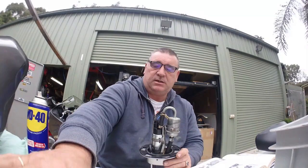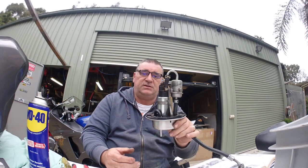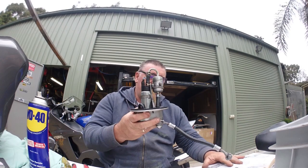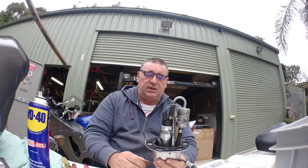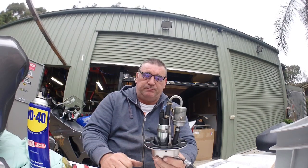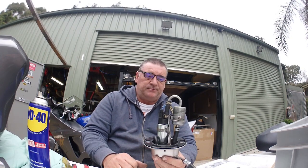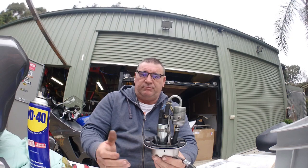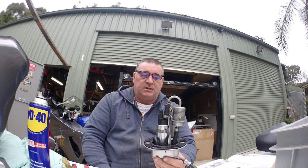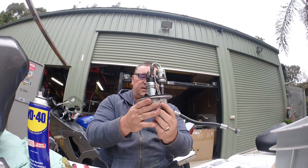So basically what had happened is that my son Lucas has bought himself a CBR Blackbird, and when we went to pick it up he turned the key on and hit the button to prime the pump, and it just clicked. A solenoid clicked, nothing happened. The bike had been sitting for quite a long time, like over a year. So we're pretty sure at that time that the pump was going to be shagged,